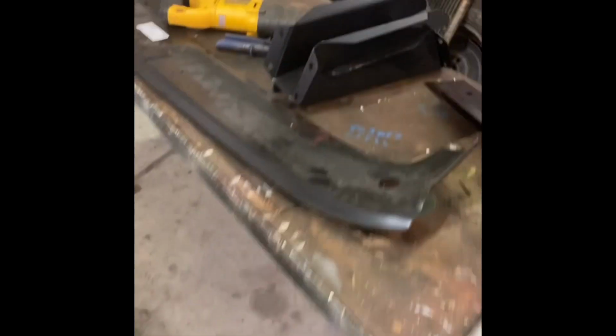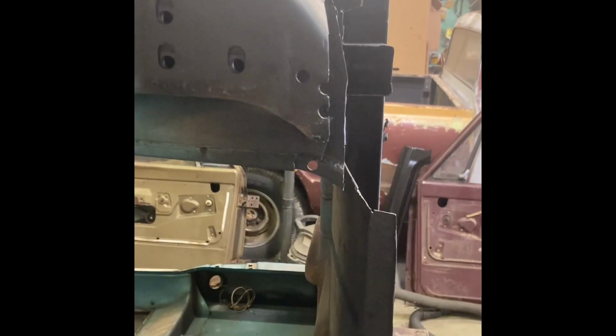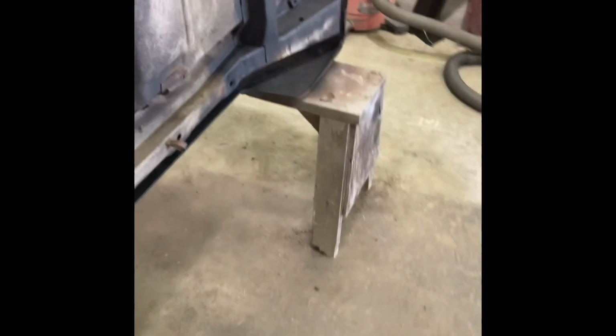And I wound up ordering another couple more pieces just because. I ordered them from AMD also, because what you get when you lose this part here at the bottom of the post, you lose these four holes. I know I can still line up the holes a little bit and get them close when I put these cab supports in, but when I have these four holes, you can locate and line everything up a little bit. By the time I do that and check my measurements on my opening, the door should go back on these hinge plates, open and shut, not hit.